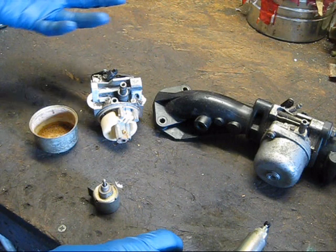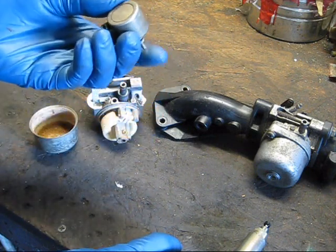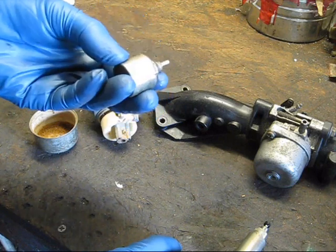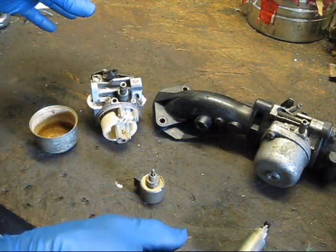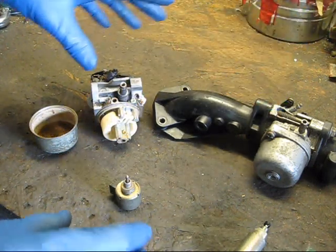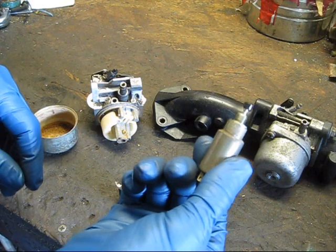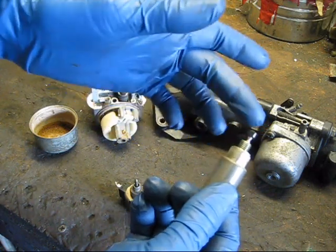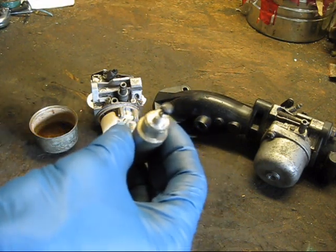Now that I've covered what they do and how they work, let's talk about the ways that they tend to fail and their reliability. If you work on small engines a lot, you're going to see a lot of these solenoids failing, and a lot of people really hate them because they do tend to have a pretty high failure rate on neglected machines, and they aren't exactly the cheapest to replace. That said, if you actually maintain your machine, they have a very high reliability rate. Quick confession: neither of these solenoids actually came off these particular carburetors. This solenoid in particular is off my '06 Craftsman which has over 2,000 hours on it — it's 100% original, never been serviced, never had to do anything to it, and it still works like new. So if you take care of your machines, you shouldn't have these solenoids fail with any regularity at all, if ever.